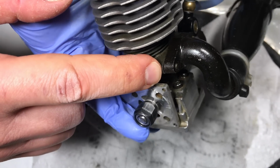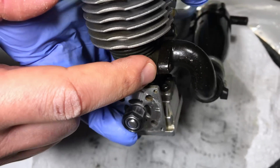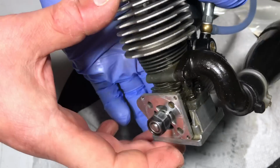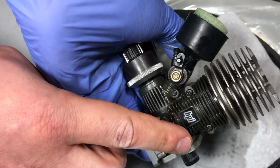Now all I need is to get an exhaust gasket here because I'm literally missing an exhaust gasket. So somebody bolted this header directly onto the motor without a gasket. That's why there's a whole bunch of oil coming from all around. The entire engine block is caked in oil. Not good.